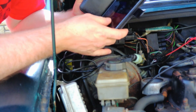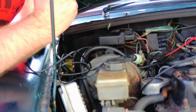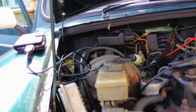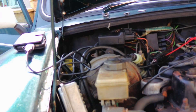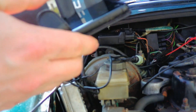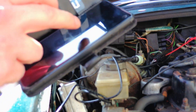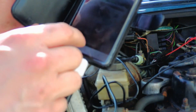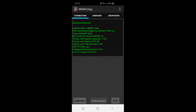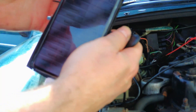And then connect it to the phone. For it to read the codes and the data, the engine needs to be running, so I'm going to get it fired up. Going into the diagnostic section — the button on the bottom left will say Connect. It asks for access to allow it to connect. Then scroll along the top — the grid view, second along, will give you all your live data.